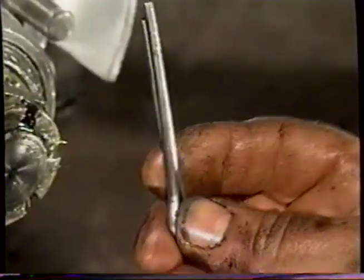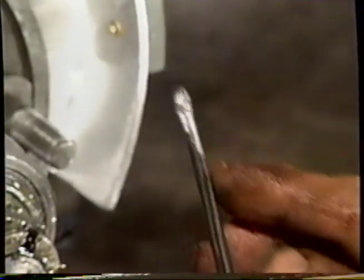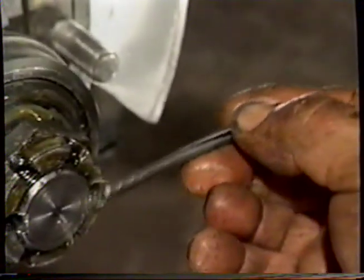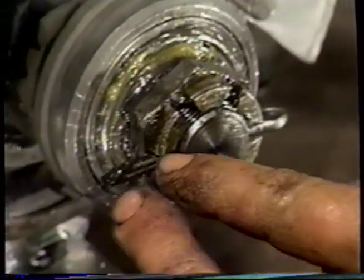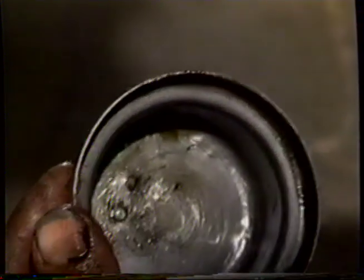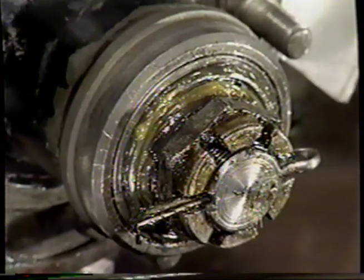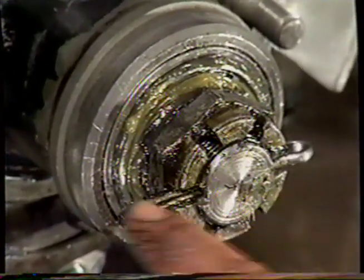We've got the cotter pin or split pin. You can see I've twisted this split pin, and the reason for doing that is when we put it into the hole, it allows the legs to come back around. Inside the dust cover, there's a static electricity grounding arrangement, and you can see that somebody's taken this one off, because they bend the split pin back on itself, and that causes that to break off, and that's what's happened there. So I've bent this around.